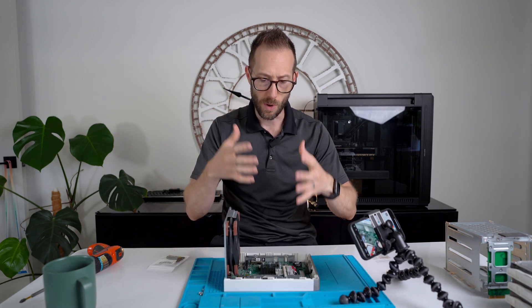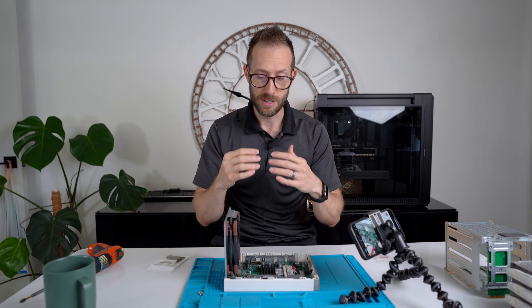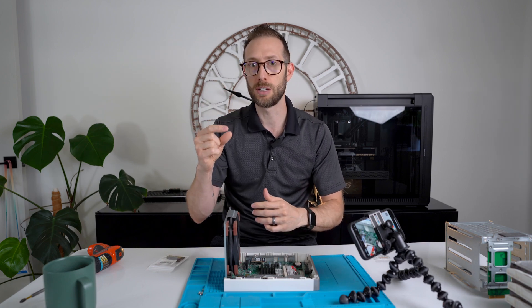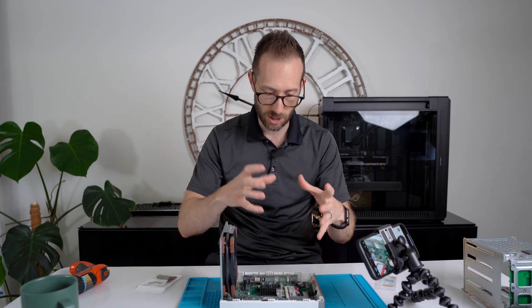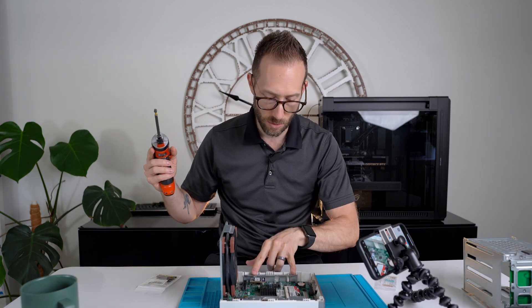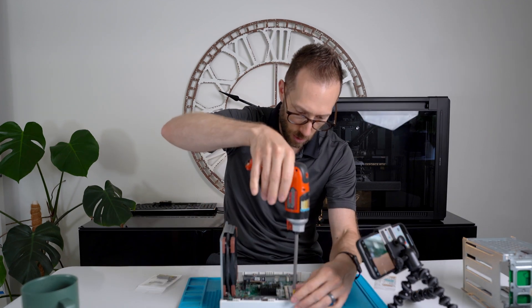If you want to learn more about why this is happening and the electrical parts and how this will help extend the life of your QNAP, I'll put a YouTube link to it. The pins are actually underneath this bracket, so I do need to take the bracket out and essentially take the full motherboard out. I'm going to continue to remove those original screws and get the motherboard out.